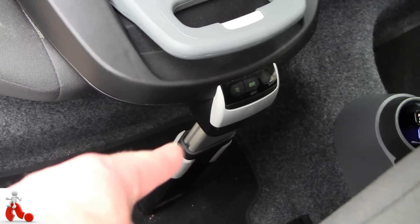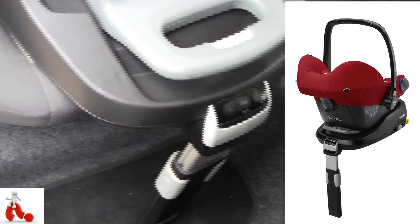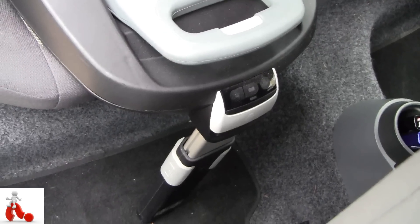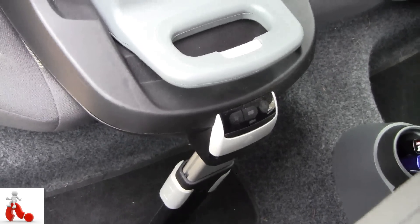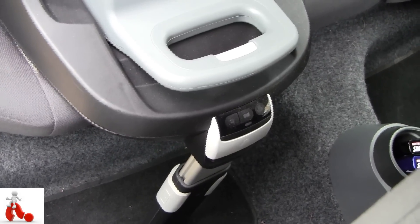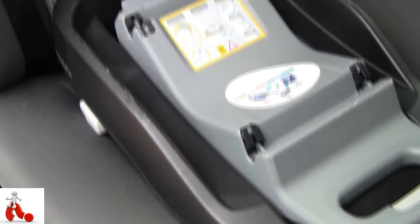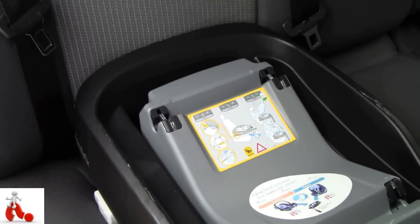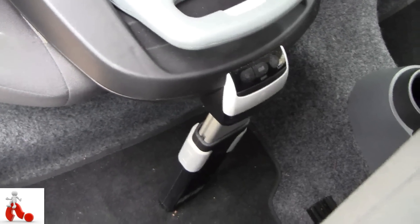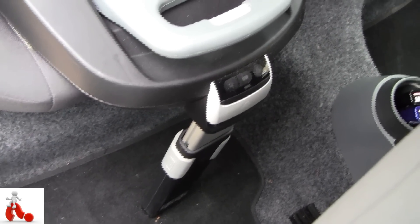First of all, down there is the leg that rests on the floor and acts as a connection point. The base plate actually checks if it's secured on the floor properly — if it isn't, it starts beeping, which prevents the seat from moving as you go along. Even when it sits on the back seat and you push it back into the isofix hooks, the back seat is still flexible, so the leg works pretty much like a leg on a table and provides extra stabilization.